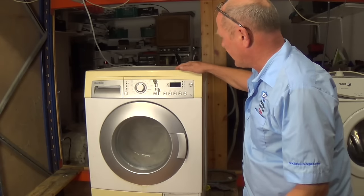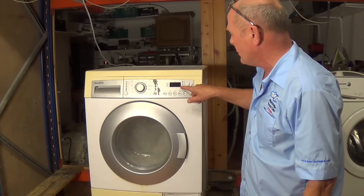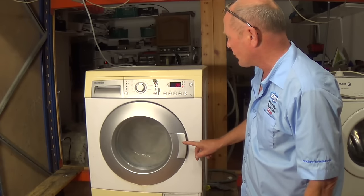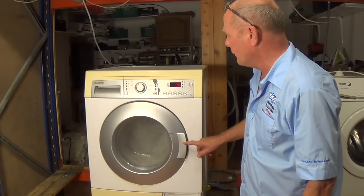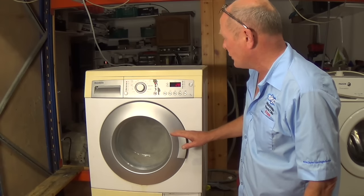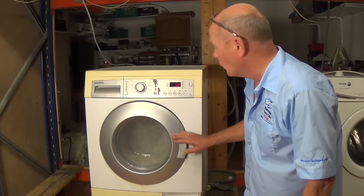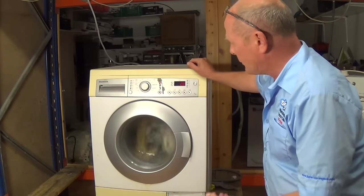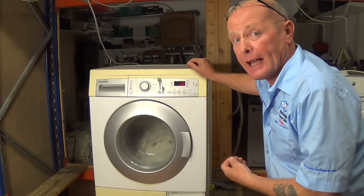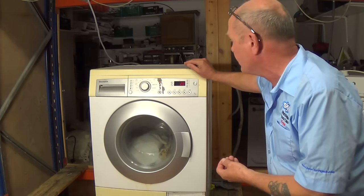Now that we've put the machine back together, we'll just try the machine the same again on the 30-minute cycle. Press start - still takes a couple of seconds for the LED to come on. We've got it set to 30 minutes, we'll just press start. The door lock should engage - you'll hear a slight click. That was the click on the door lock, the machine's now filling. And in a few seconds or so we should have some motor action - this is where it was kicking out before and the display was going dead. And there you go, the machine now is turning. So for the cost of a few pounds in components and the effort it takes to strip the board down and have a look, it's well worth having a go, especially when you consider manufacturers are charging in excess of £100 for a circuit board.